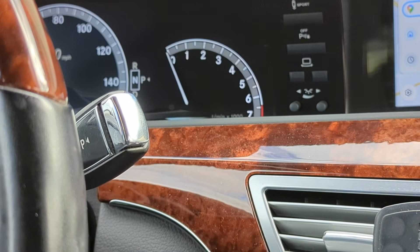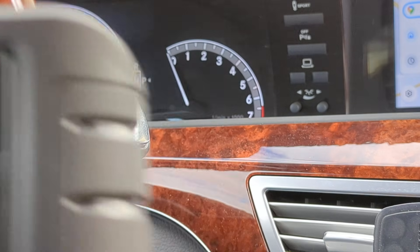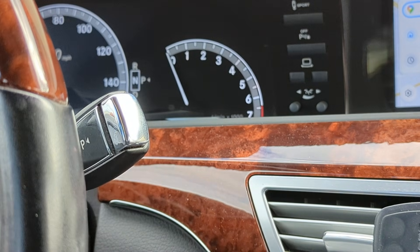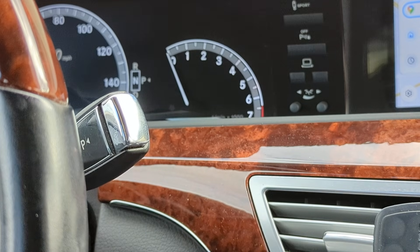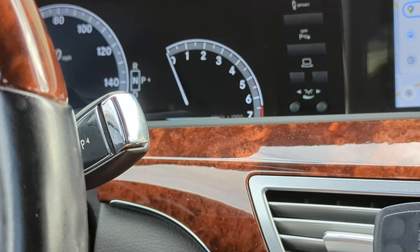So that's it. If you don't have a key, this scanner method will work. These are really the only two ways to put a Mercedes with a drive-by-wire transmission into neutral. There is no mechanical release you can press, like there used to be on older models where you could press and release the shifter. These are drive-by-wire and computer controlled. So you either have to turn on the ignition, or if you cannot, use the Econic scanner to get the transmission into neutral.